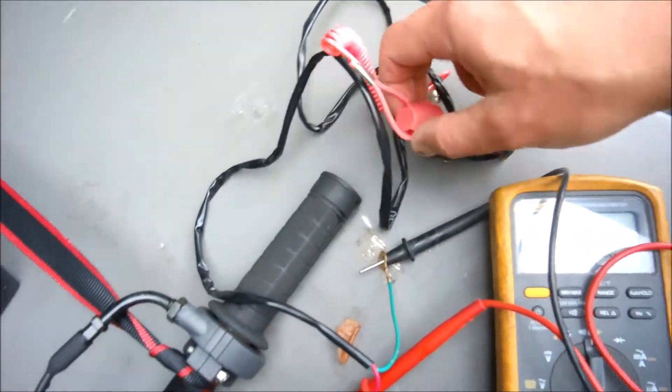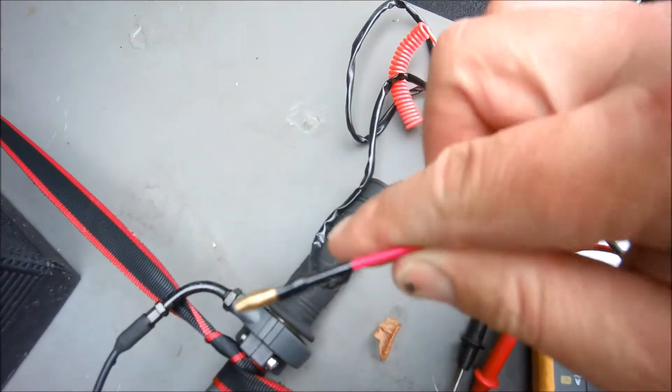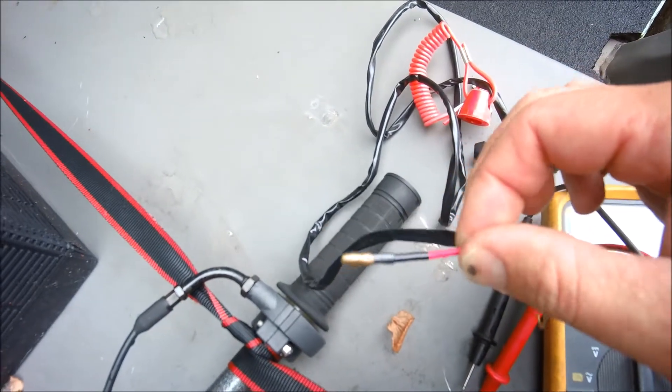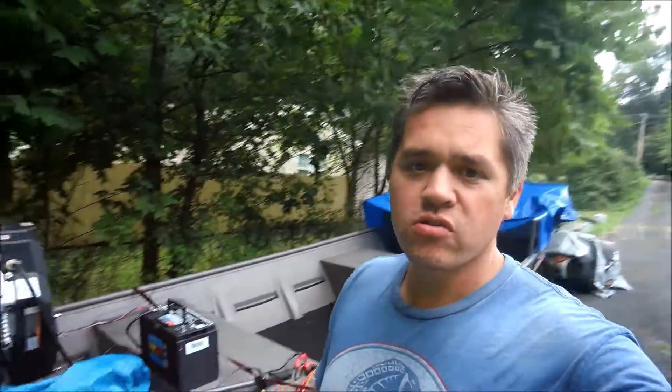It's going to short to ground. All you gotta do is land this red wire, and we can tie it in to the low oil sensor. These engines are meant to run on generators and pressure washers — stationary equipment. The oil is not expected to be splashing around everywhere. If the waves are really bad and you get caught in a storm, you do not want your engine to shut off because the low oil sensor is killing it. Having to keep restarting it could be a dangerous situation.